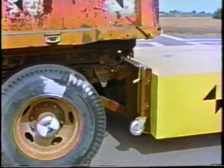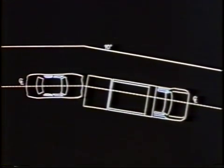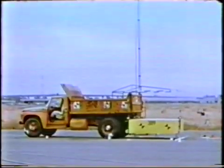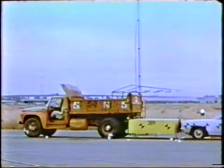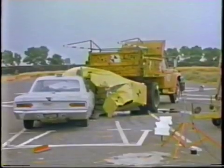The final test, number 389, used the same truck as in previous tests, and the car was a 1970 Plymouth weighing 4,270 pounds. The primary purpose of the test was to evaluate the efficiency of the lightweight attenuator while being impacted at a 10-degree angle at one foot off the truck's center line. The car struck the attenuator at a speed of 45 miles per hour. The occupant impact velocity was 20 miles per hour. The car penetrated the attenuator seven feet, crushing the grille back a maximum of 24 inches on the right side. The truck skidded ahead 14 feet and to the right about two feet. The attenuator was completely crushed on the left side, and the support was twisted and deformed one inch in this successful test.